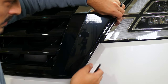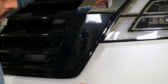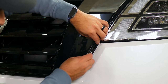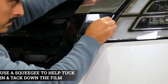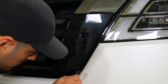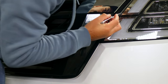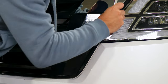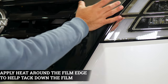You could lift the excess material just a little bit up and tuck in as much as you can since there is a small gap between the grille and this section of the panel. That way you don't have to trim off too much excess material and it's still covering the chrome. Lift it and tuck in as much as you can. Do the same for the bottom section. Now we can trim off the excess material — find the gap right in the middle, carefully trim off the material. No chrome showing — good to go. Apply heat to seal it around the edge, and then move on to the next piece.